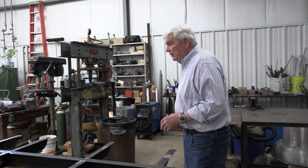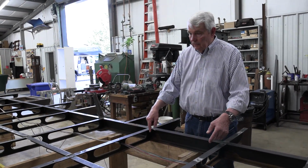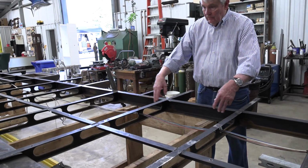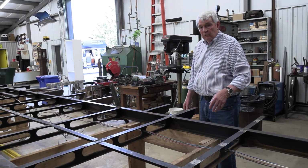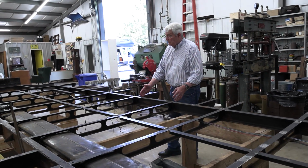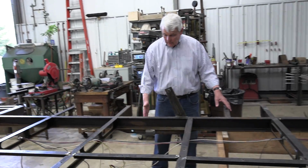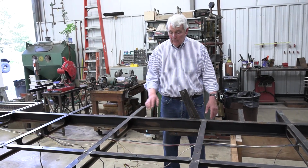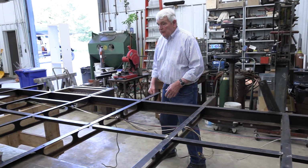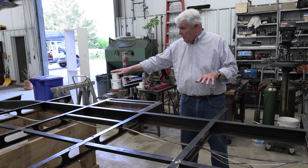So the idea is that we'll take tanks that have approximately 16 gallons each and represent an area that fills probably 90% of this space, and there will be 3 tanks for the gray water. 1, 2, 3. They will be interconnected. Then, for the purpose of balance, since the axle is right here, so this is a pivot point, so we don't get too much weight on the back, we're going to jump over and put the 3 water tanks, 1, 2, 3, up here to provide more weight for the tongue.